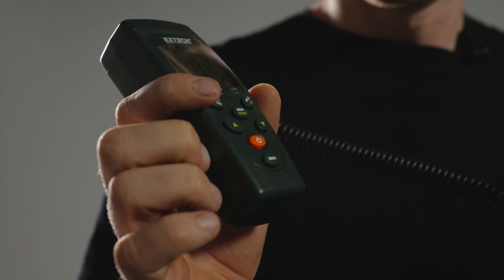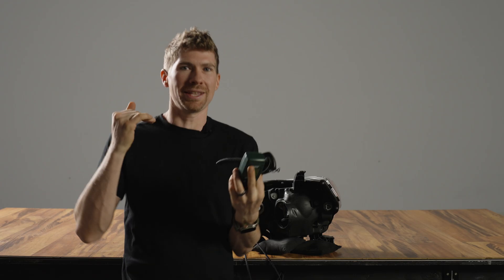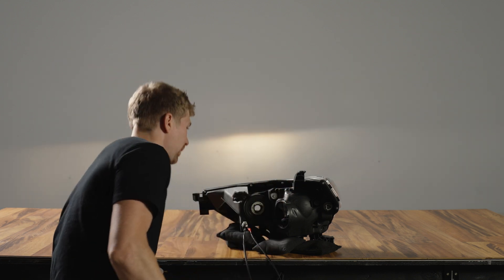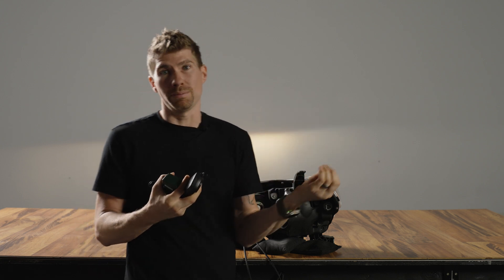Here's how we're gonna do the test: I've got a digital lux meter and we're gonna measure the actual usable brightness at a certain point — the max intensity. I've got the passenger side headlight on the table connected to a power supply. I'm just going to install one bulb after another to show you what low beam looks like out of all of these LED bulbs. We're trying to find the brightest and the one with the best beam pattern — something that replicates your stock halogen light.